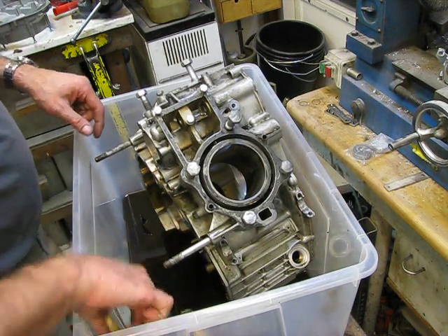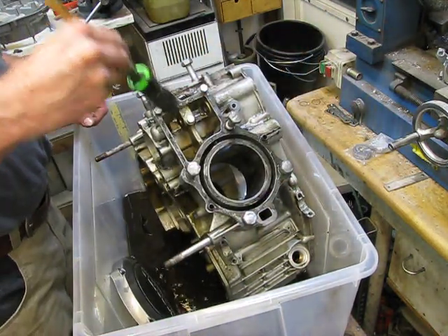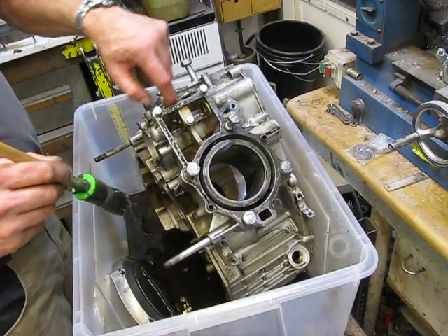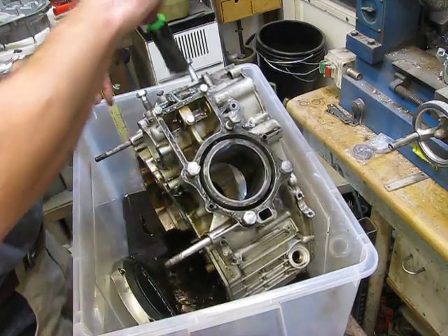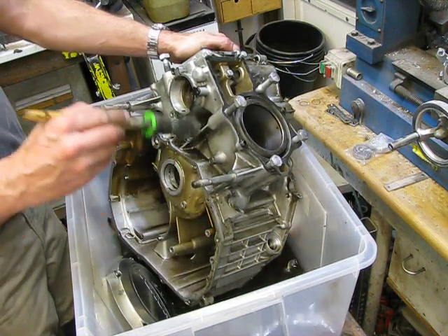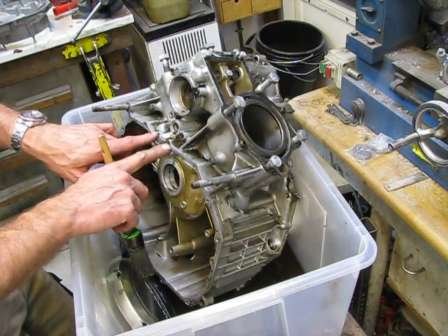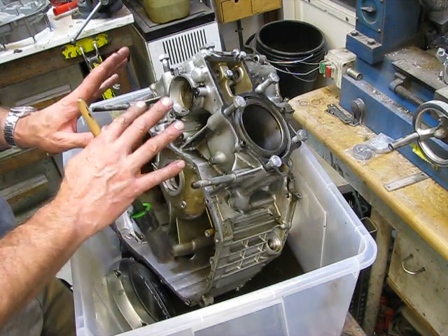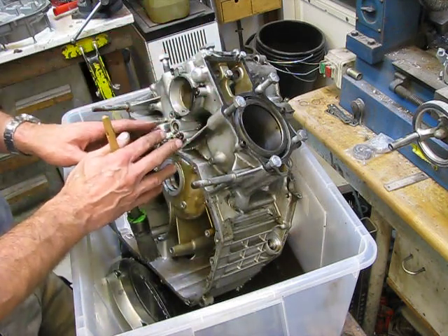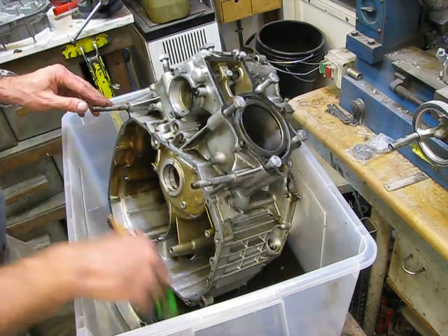So what I'm doing is cleaning the engine out. All the fat grease has to go. And then when I'm ready, I rinse it off with brake cleaner. You may still find black grease on the engine — don't worry, you can blast it away with some sand. But really, the thick grease here has to be removed. If you think the sandblasting isn't right at the end of the process and you're not happy with it — don't worry too much, because the radiator is in front of it and you won't see it. But I want to do it perfectly, so I do it perfectly.